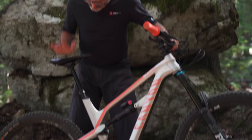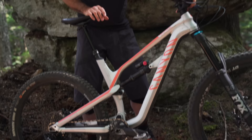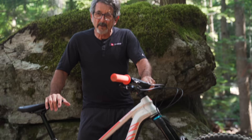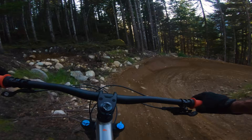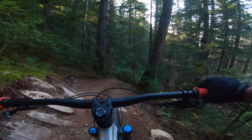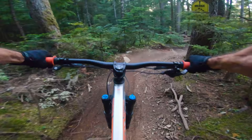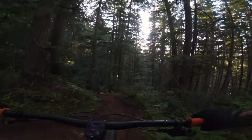The seat angle is 74.5 degrees — you'd want it to be around 76–77 if you want to be vanguard, but this is about as slack as it can be and still be an acceptable modern trail bike. The chainstays are 430 millimeters, which is good for a 27.5 inch bike, and the reach is 440 millimeters — right in the middle of that range you want. The top tube is a little under 24 inches at 605 millimeters, which is generous. This is a bike that covers a wide range of riders.